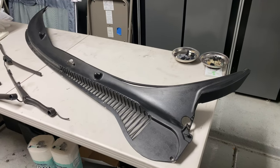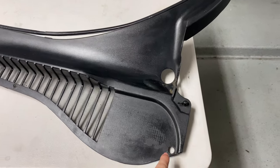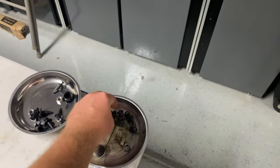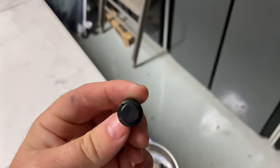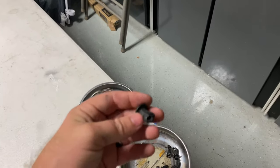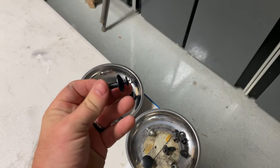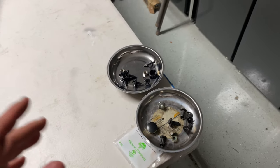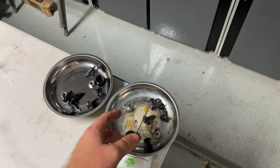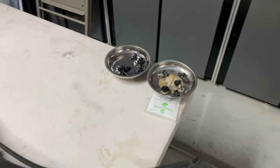In order to get this thing off the car there are a few steps to follow — it's actually not that hard. There are several holes in the front of the tray that have plastic pin clips inside them. Really easy to remove: just get a flathead screwdriver, lift the center section up, and you can pull them right out. These are getting old and brittle, so I've got some new ones from the local hardware store. It's always a good idea when taking stuff off these older cars to just replace the plastic bits, because usually they're going to fail.